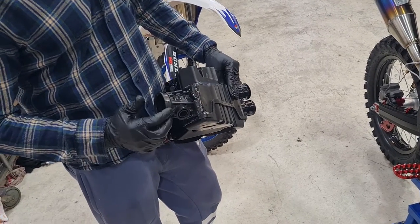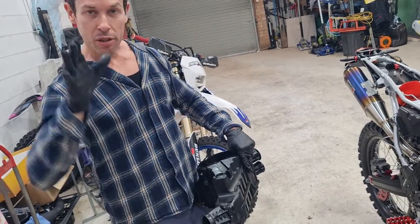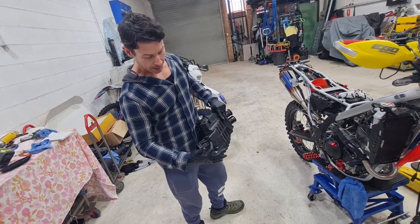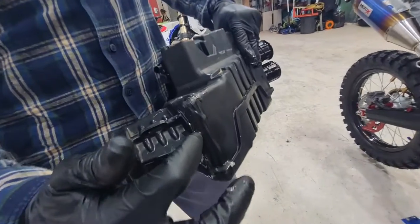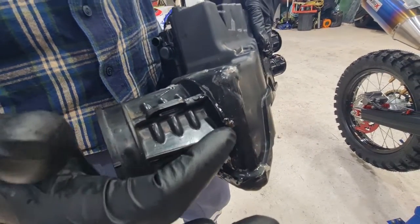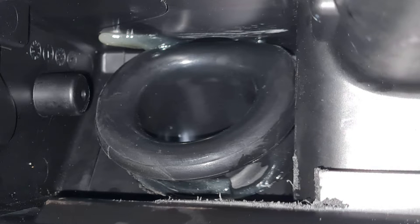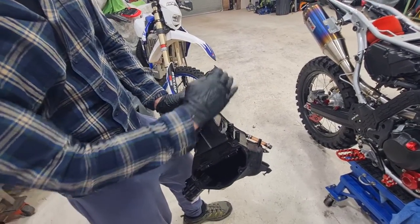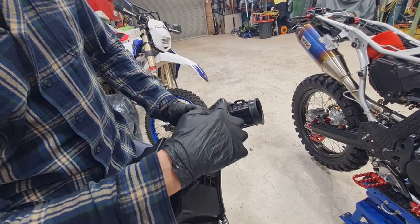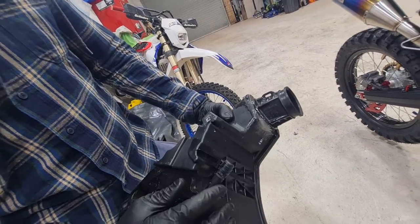Aaron, take us through why it's at the angle that it is and why all the bolts don't properly line up. With this intake, I found that the top — the intake's got a bell, like a high-ram airflow design. To get the bell to sit inside the airbox without restricting or folding the bell over, you have to use the groove of the original boot. It sits up the top — there's this little rubber locator right at the very top. All this top part sits into the groove; the bell sits in very well inside the intake. But to get the angle — the angle of the airbox has to be very, very close to the angle of the flange to match up with the throttle body. To get that, you've got to manipulate this area, and then it leaves a gap on the bottom, so you've got to build it up with epoxy to get it to sit out around the eight millimeter mark to match up.